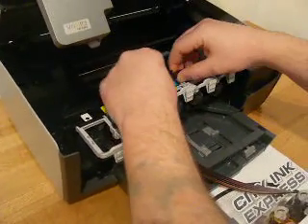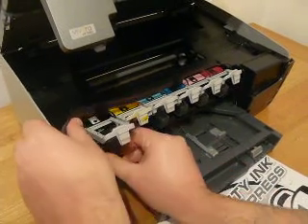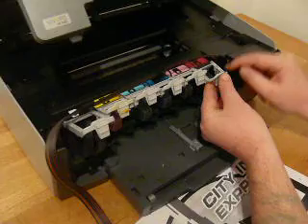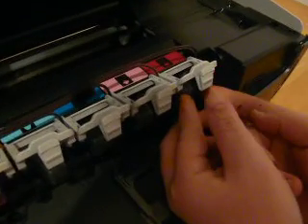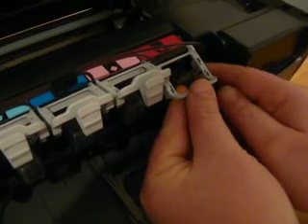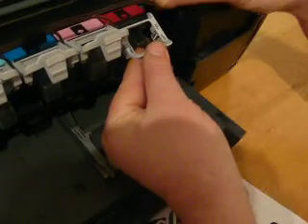On the back here you will see the clips — these are routing clips that we're going to use to tidy the ink cables up. Before we actually close this lid, this bit's quite important. On the edge of this plastic clip here you will see a small recess — it's a tiny little U shape. This should be where your tube comes out. If you don't have the ink line coming out there, it is possible to crush the tube. So I'm now going to install this one.